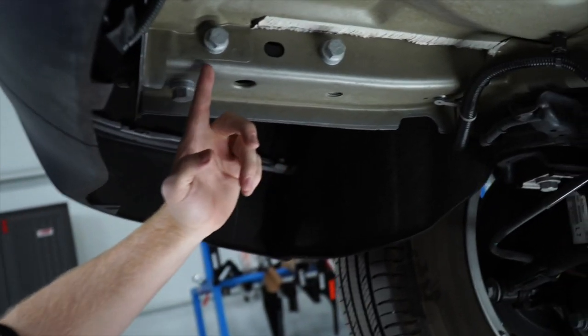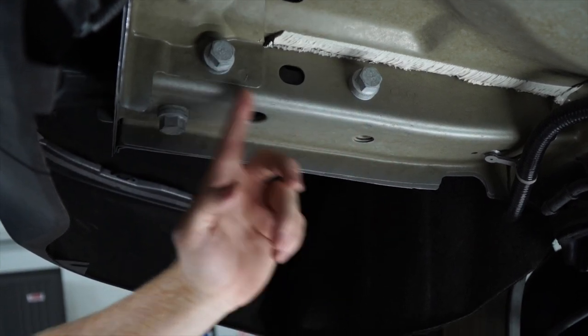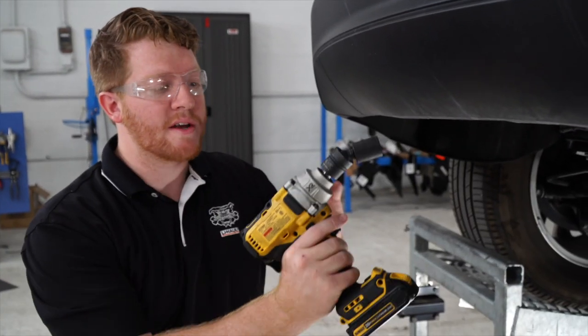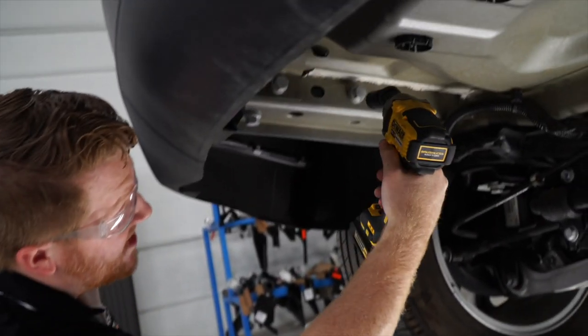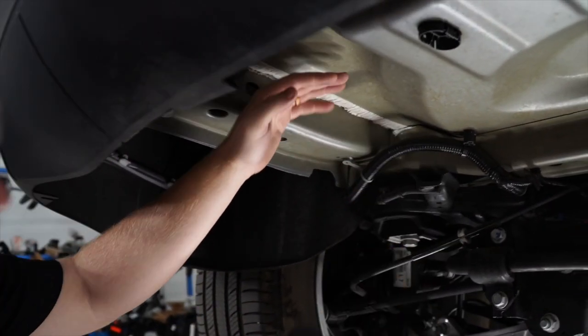So on both sides of the frame rail there are two bolts on the side. We're going to go ahead and remove that on the driver side and on the passenger side, and this is where our hitch will line up. To take out those four bolts we're going to use our impact drill and a 21 millimeter swivel socket. When you bring it into place you can see that the trunk is a little slanted, so using the swivel socket will give us a little bit of room to take that out.